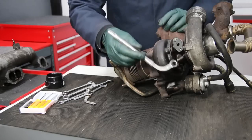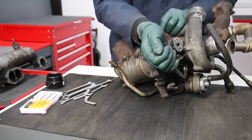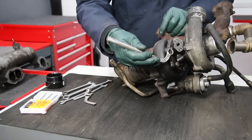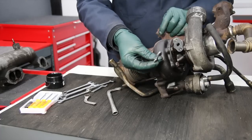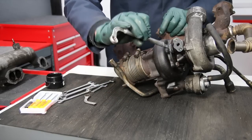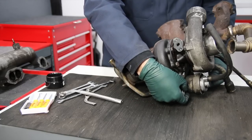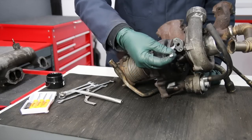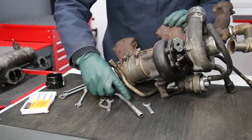This isn't too bad on a bench, but when the assembly is down in the engine it's really hard to get to some of these bolts — that's why I came up with a few special tools. The curved box-end wrench allows you to get way down underneath on the bottom bolts, angled so you have clearance to loosen and tighten. With a standard box end there's not enough room, so I made cut-off short sections; if you have room, you can put the other end of the wrench on for leverage. Sometimes you'll need to go way underneath with one of these short pieces, possibly using pliers to break a bolt free.